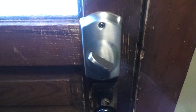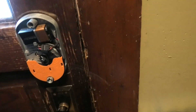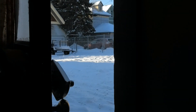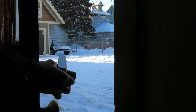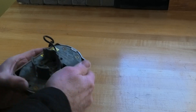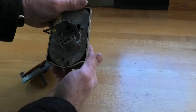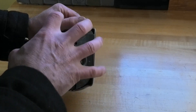So I can take it off on the backside — there's a couple of screws. Let me get those off and open it up. We've got our electronics under there but the mechanical part is the stuff outside. I'm going to take these two screws out here which will release the outside. I'm trying to get this done before it warms up and the problem disappears. When you push this button you can see how this part here has to move, and something's happening when it's cold that isn't allowing that to move. I've got to take some more screws off and get inside of there.